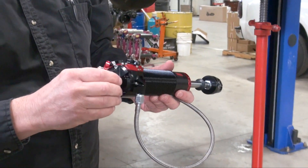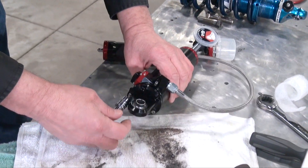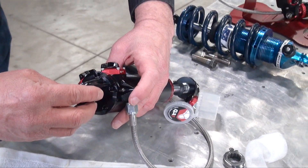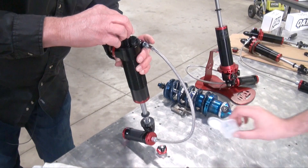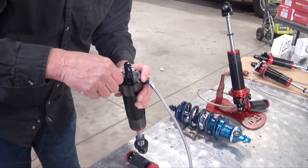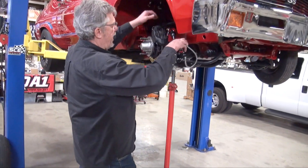Like Marshall mentioned, we have indexable bases on all our Mod Series shocks. I'm going to quickly loosen up and grab a tool. What's nice is when you take the base off the shock, there's no oil and no contamination inside the shock body. This is something you can easily do right at the track. I'll re-index it over here — right there, that looks good. The shock has spherical bearings on both ends, which minimizes any binding and gives you a lot of articulation. I'll stick it back in there and see if I've got it clocked the way I want so I can easily access the adjustment knobs.